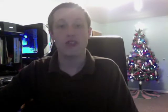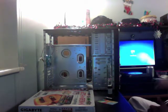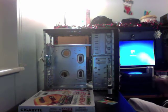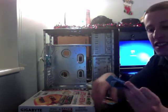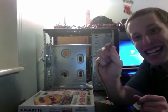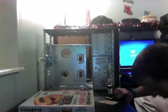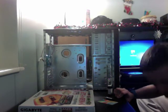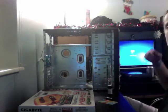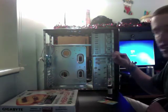I'm going to show you the motherboard and we'll go from there. I'm going to pull out the motherboard here, and you're going to see an item in my hand — this is an anti-static wrist strap. Very important when you're working on a computer that you have one of these. Computer parts do not like to be touched with static electricity; you can ruin parts that way. That alligator clip on it — you'll clip it to any of the metallic parts of the case of the computer.